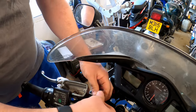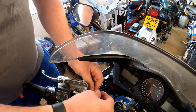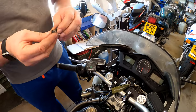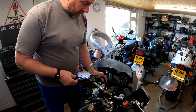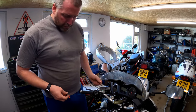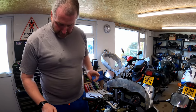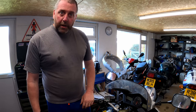If you were expecting any fluid to come out then get some workshop rag or tissue around it just to catch anything. There's the other banjo with the two washers — that's no longer required. Now we are ready to pull the old hose out. I've got a little plan and I'm going to give it a go and see if it works, so let me grab the new line and we'll set about getting it installed.